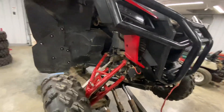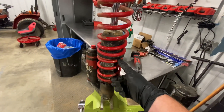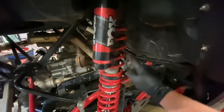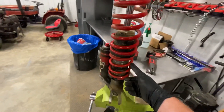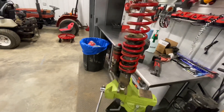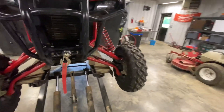As you can see, I've got the machine in the air. Stock tires are on just because I've been road riding, and I pulled the shock off. I currently have the All Things UTV tender springs — only the upper springs. These lower springs are factory. I do have those All Things UTV tender springs front and rear. The reason I'm switching is I want a more plush ride. These All Things UTV springs do a decent job, but they more or less do a better job of just giving you ride height as opposed to quality. Quality is what I'm going for.